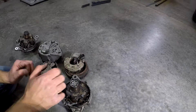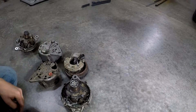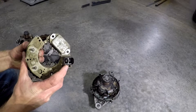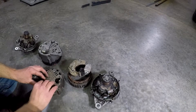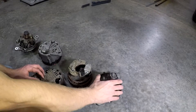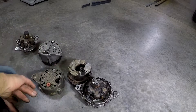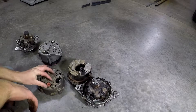There are three kinds of alternators you can put in a 720 — two came factory but you can run three. One is the generic Nissan T-plug alternator that they ran in all kinds of things, mostly Z24 D21s, which will be your top candidate for sourcing one. The only challenge is that quite frequently they have a smaller front pulley than what came on a 720 alternator, so you may need to convert to a D21 belt to get it tight enough.